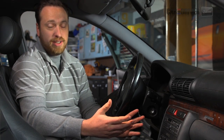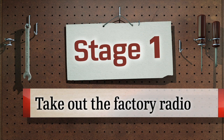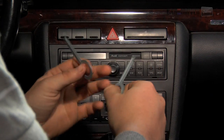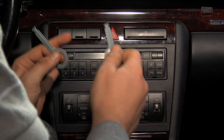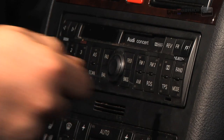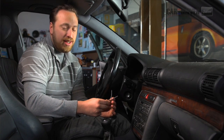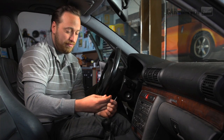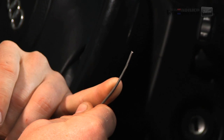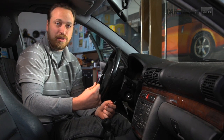We're going to just jump right in and get to it. To do this job, you only need one tool really, and it's these guys — these radio removal tools. It basically fits into the radio; the front has a little slot and they fit in there. What it does is release a little tang inside that's holding the radio in. You can get them at auto parts stores, but I just made a tool — I took a hammer and smashed a piece of wire thin. It does the same job. You can probably make it with junk you have in your garage.